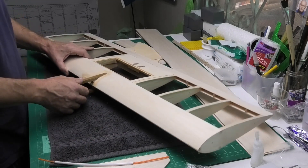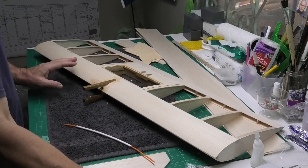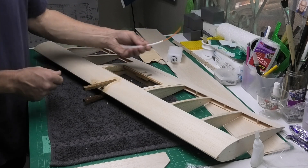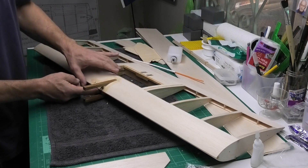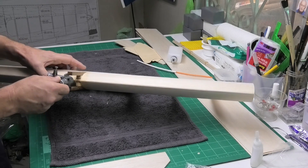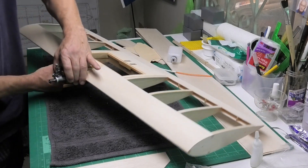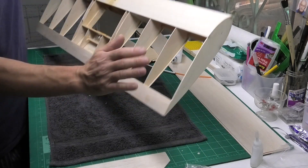Confession time - I suddenly realised that I hadn't put in any control linkage for the engine. So the engine is going to fit on the front here. I've got the fuel tank coming in with the fuel leads. And there's a very simple route for me to follow with just a flexible hose that's going to come down, tucked down the side of the fuel tank and just coming out of the leading edge here, which will line up nicely with the throttle control on the underside of the engine. So that should be quite an easy solve. That is the very first thing I'm going to do - the throttle linkage, and then I'm going to sheet the underside.